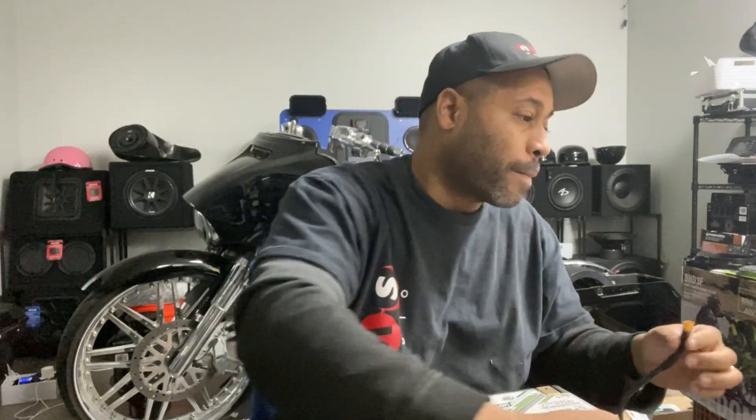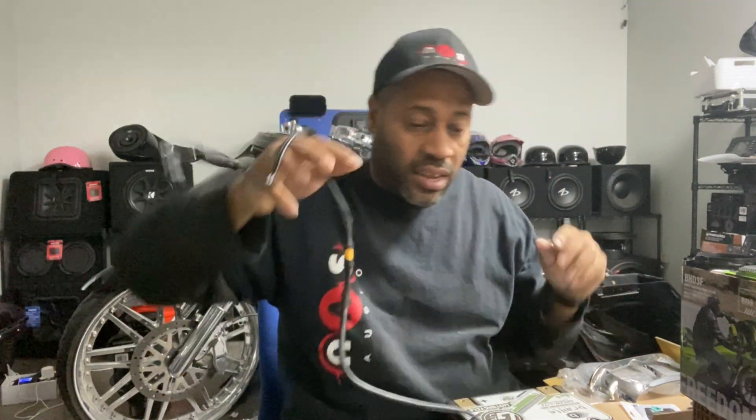So let me show you what it looks like when it's all finished. We have one here that's completely done. We use XT60 connectors because they can flow a ton of current, so now it's a serviceable quick disconnect — there are your alligator clips, and here's the tender side that's going to plug right in. So you're talking less than $20 in parts and you now have a factory Harley-style connector. Now that you've upgraded to lithium, use the tender that came with it because you can't use your Harley tender — it won't charge your lithium.